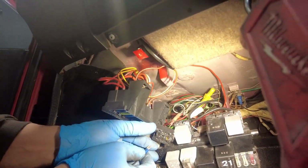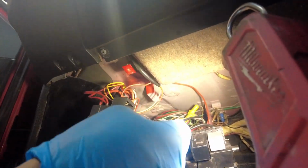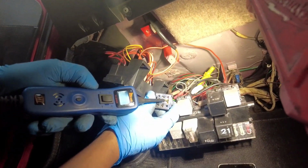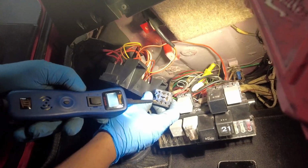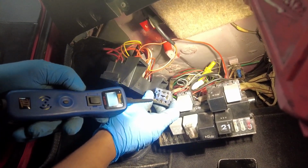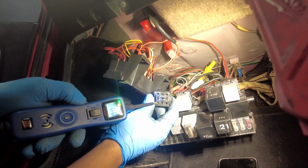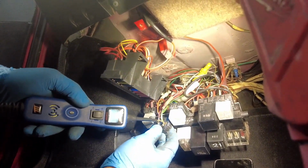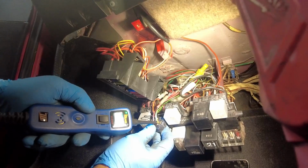So explain what you'd see. So here, on this pin here, it's rusty. Yeah. All around the pin. Yeah. The others look okay. That one looks a bit discoloured. Yeah. But you touch the power probe on it, it's still working. And it's the same, probably can't see it very well. Oh, saying that, so it's only terminals. Yeah, it's only terminals. You can see the rust has come through the back of that.